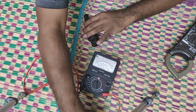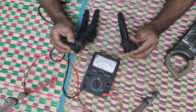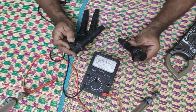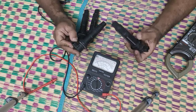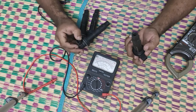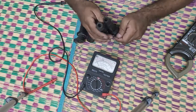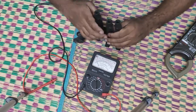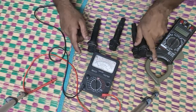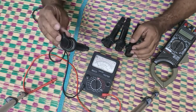In case you find the readings are uneven between the stick coils, that means one of these is going to go bad or is not functioning properly. That means you're not getting proper ignition to your spark plug, and you may end up with misfiring, no firing, jerking acceleration, and various other problems. This is how you check with the analog multimeter — it's the same process using a digital multimeter. Thanks for watching. This applies to FZ1, R1, or any bike with a similar stick coil.